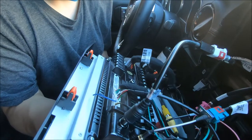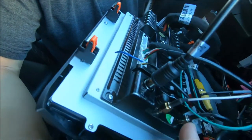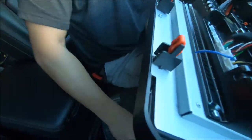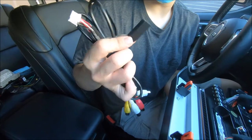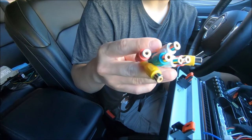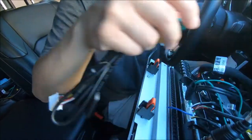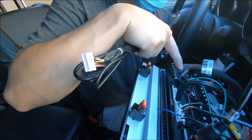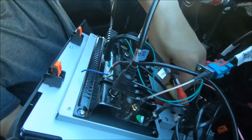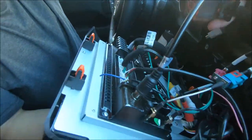Just to go through the connections one more time: you have three at the top — the radio antenna, the GPS antenna, and the 4G antenna for the SIM card. You have one SIM card slot on the back, and this harness allows for another SIM card slot. These RCAs — you can read the labels — there are two channels on one and two channels on the other for a total of four. And you have the power connector, factory backup camera LVDS, camera connection, and the air conditioning.